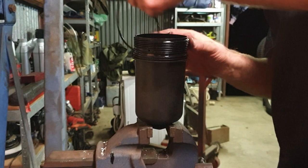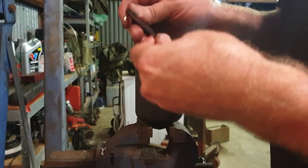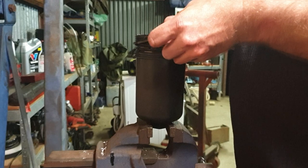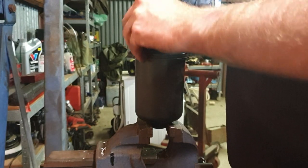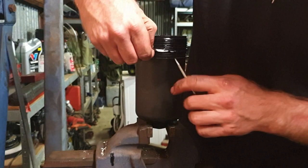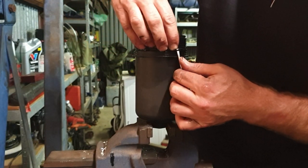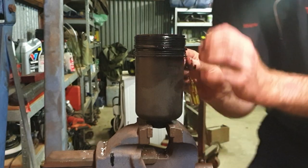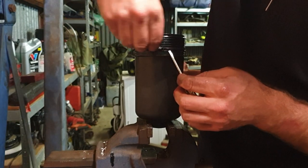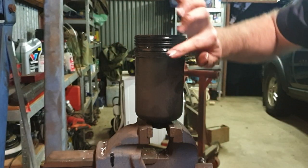There's a little o-ring just in here you can get changed out. There's not only one in the kit. So I just put a little bit of oil on these o-rings, just helps with a little bit of lubrication when they're going in. Now these are a square profile o-ring, so if you just whack it on, it'll often twist up. Little trick — just get a flat blade screwdriver just under the o-ring and just slide it around while sitting in place behind, and that should straighten it out, or basically untwist it. Just run your finger around, make sure there's no twist on that o-ring.